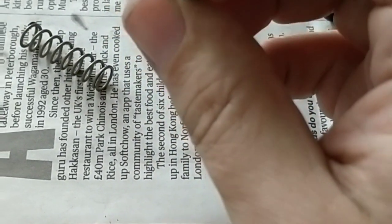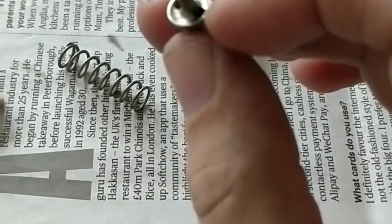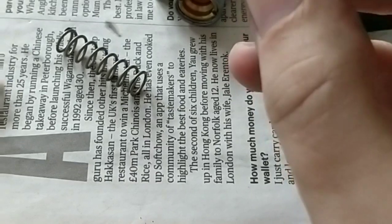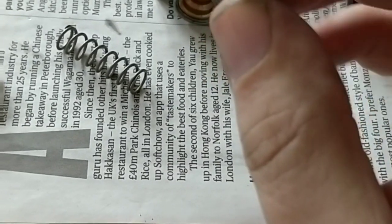The other thing that I'm looking to do as well is the holes that are here obviously are restricting the amount of gas that you can get through in that split second when the plunger is struck. What could potentially be done, and this is the second part of what I will do, is slightly widen the holes on both sides, not by much because I don't want to weaken the integrity of the valve, but certainly try and increase a little bit more gas flow.